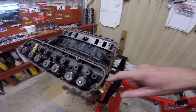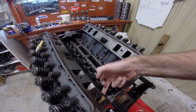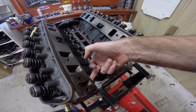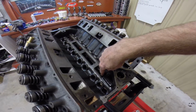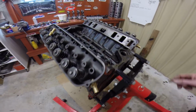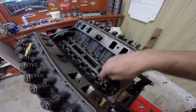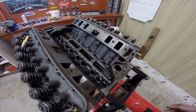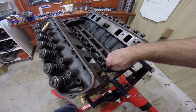The trouble is, if you've got them going through the heads, yes, they come back out in under here and down through there, but what happens when it goes down through to the camshaft and then it hits straight onto the sump? Not onto the sump, sorry guys. It'll hit straight onto the crankshaft, and as the crankshaft's spinning flat out, it's just going to get sprayed everywhere. So it's not an ideal situation.